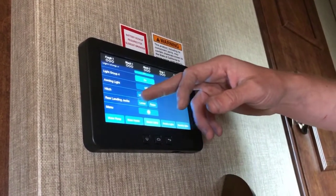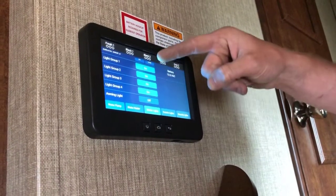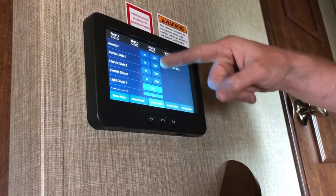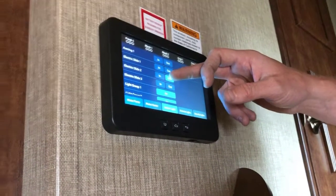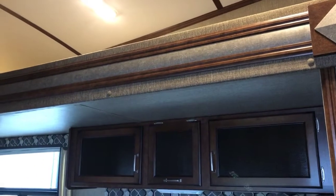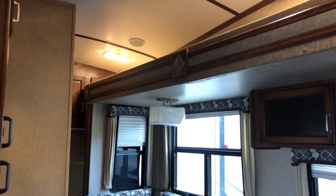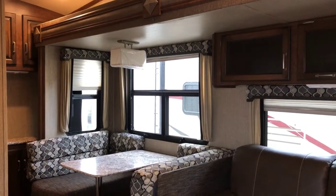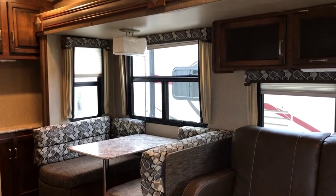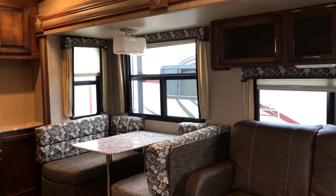You can raise and lower the hitch, raise and lower the rear legs, and control the awning light. We've got the master lights on right now — all four lighting groups turned on. You can also operate your slides. We've already extended two of the slides, but we'll just extend the third here by pressing and holding the out button. It's an electric cable driven slide, so it just runs straight in and straight out — extends just over three feet. Just hold your finger on the touch pad until that slide is all the way extended. Once you hear that motor start to labor a little bit, you know the slide is all the way out.